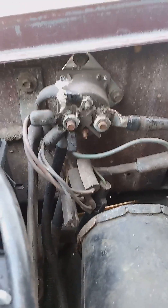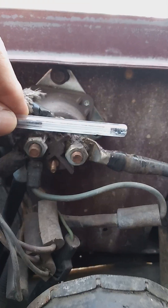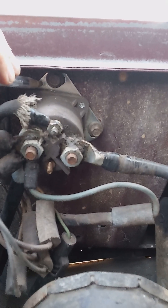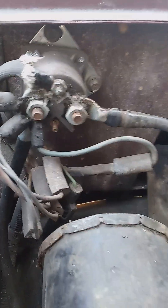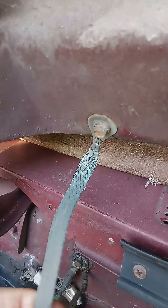The other ground that's here — not really apparent — is this metal plate grounding this inner coil. When you turn your key to the start position and this closes the plate, that's an electromagnet. It needs a ground. It's connected to this metal plate right here. That's why there are ground jumpers around in different places on the truck, and one of them is right here. See this braided line? That's a ground jumper — it's a bonding jumper.